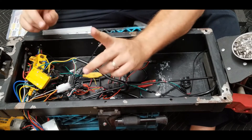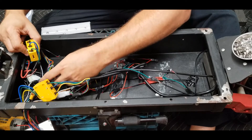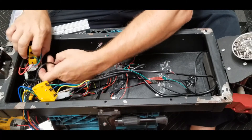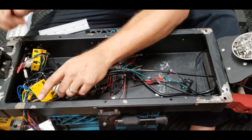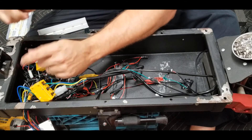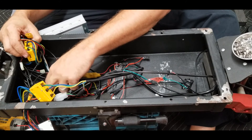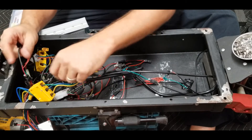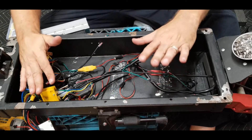Let's go over more of this wiring. They have two connectors for the hall sensor wires and the motor wires, and then all of that goes back to the controller — usually a five or six pin connector on the back of the controller for your different settings, voltage readings, throttle, and all that. Most of this wiring coming out of here, if you just follow it, a lot of it's going for the lighting. Don't get intimidated by all this wiring sitting in here — it's fairly simple to figure out if you just sit down and take the time to do it.